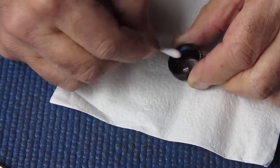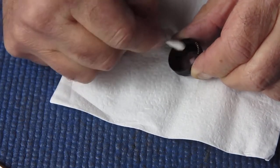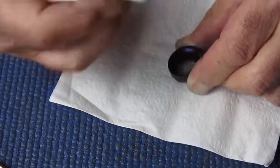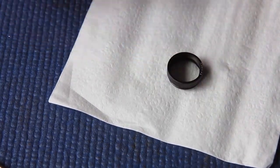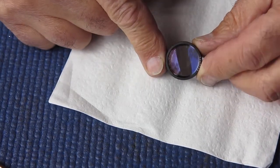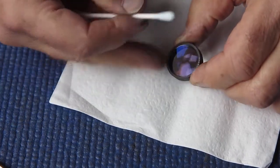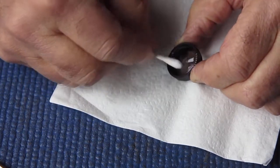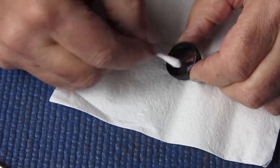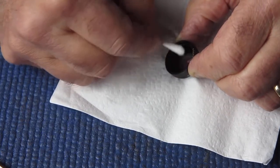This is the same Retina C-type lens that you would find on a 3C, 2C types. In the case of the Reflex model, the mount for the rear group is slightly different. The glass actually protrudes out beyond the mount, which is not the case with the rangefinder cameras. With the rangefinder cameras, the mount extends out past the glass, or very close to it. You can use a lens set taken from a Retina Reflex and put it into a rangefinder camera and you'll have no trouble.